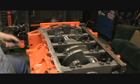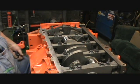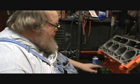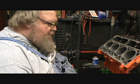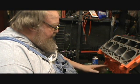Alright. Okay, well, I don't know if I want to put one piston in or if this is where we're going to call it, so I'll be back. Okay. You're going, hey, what about these down here? Well, those are going to go in, and they go in at 18 foot-pounds, the outside main bolts. But it's got a silicone, I got some special gray stuff that you put on the bolt, put it in, then torque it down.